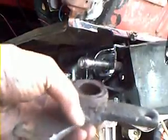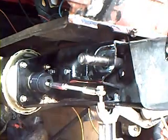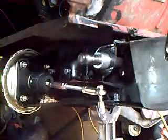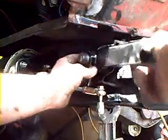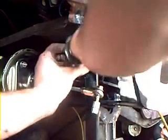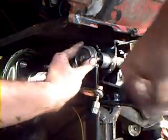Now in the past, we would take our clutch pivot piece here and cut all this stuff off. But the folks with the kit were nice enough to give us one already done. So we can just slide that baby right on. We'll slide our washer on. Slide our brake arm on. Slide this piece on with the deep side facing in, our spring, our outer washer, and then our clip, which is bad, so we're going to get another one later.